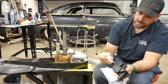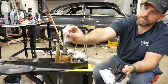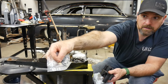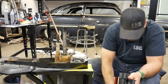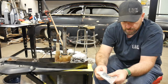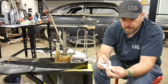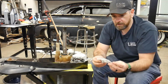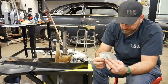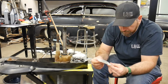So in the back here, you can see this Quicksilver kit. The O-rings or gaskets for the drive screws are the yellow gaskets. I don't know if you can see that. So these yellow gaskets in here are a nice yellow gasket. So another thing that I noticed now too, between the cheapy kit and the Quicksilver one, is in my little bag here, which I'm used to, it actually comes with a new keyway for the impeller. So there's a new keyway in there. There's the bolt, this little bolt that goes on the end that you'll see when I pull it out. And a couple other O-rings and stuff. There's actually, if your drive uses a pin, there's a pin in there. Anyways, that's kind of cool.